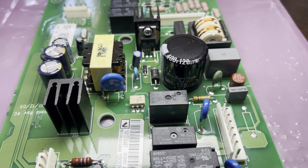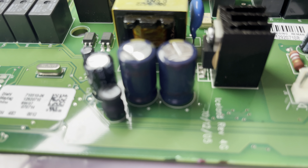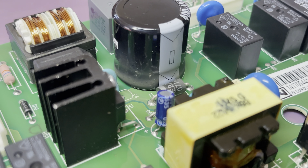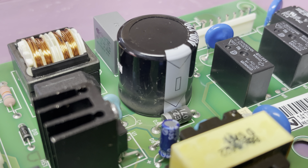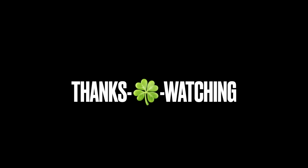Here's the board I took out that was damaged. Just doing a little investigating to see what might have caused the issue of the ice and water dispenser not giving me what I want on demand. Looking closer at that big capacitor, you can see the discoloration at the bottom and a little bit of warping — likely the cause, the culprit. Hope this video was of assistance and some education. Thanks for watching.